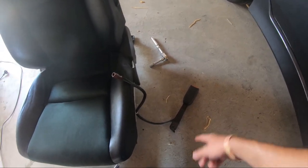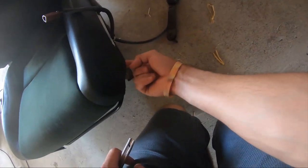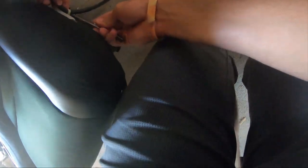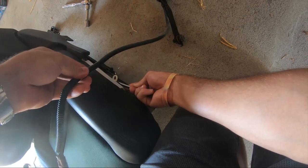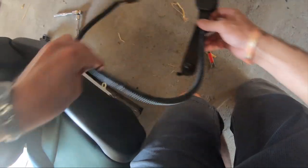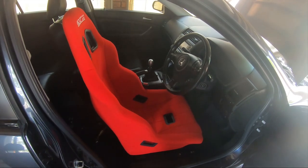To get the factory seat belt off it's really easy — there's a 14mm bolt on the side, this plastic part here pops open, pull it straight out, feed the cord up and over the rail. Get yourself the plastic connector — there are two ways to deal with these: you can simply put a blade underneath the little bit that holds it latched and release it, just like so. Or the other alternative is on the back you just squeeze in the two tabs and it closes.